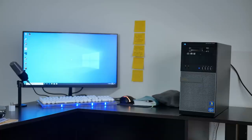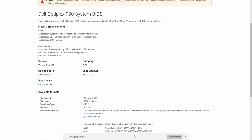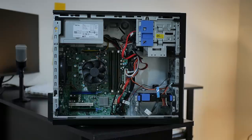Next, click the BIOS download link that corresponds to your Optiplex model in the description and run it to update your BIOS. Your PC will restart once or twice. That's completely normal. Turn off the computer, unplug everything, and then open up the case by lifting up the flap on the side. You see all of those cables connected to the power supply at the top? Yeah, we're gonna unplug every single one of them.